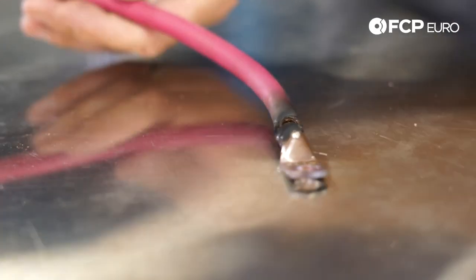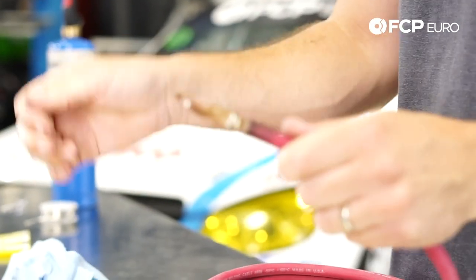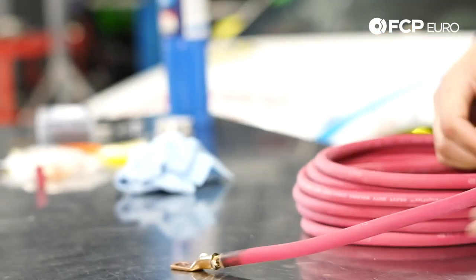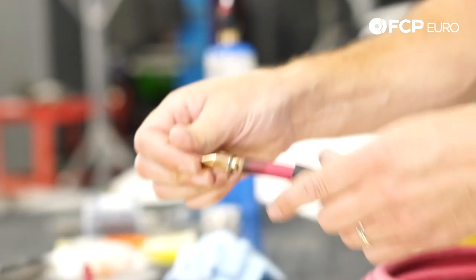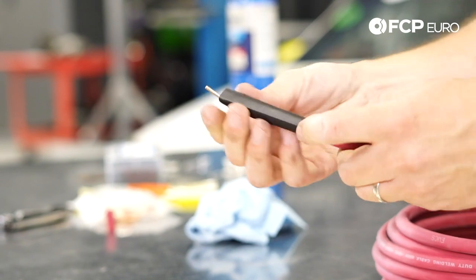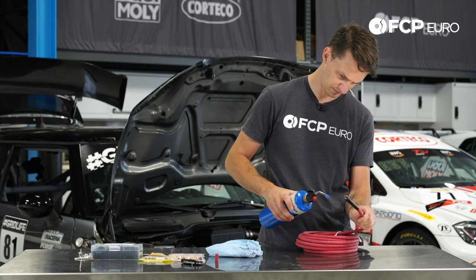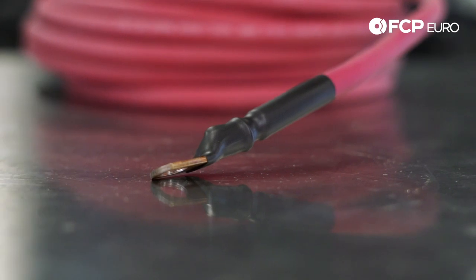Just some rubbing alcohol to clean up our mess. Now we've given the end ample time to cool down — you can see we have a really solid soldered connection there that's not going anywhere and it's going to transfer all the electricity through it properly. We've also run it through some water to make sure it's nice and cool. Now we're going to slide this heat shrink right down — you can see how kind of ugly this is, but now we're going to cover all that up and make it look nice and pretty. Sliding the heat shrink down and over the shoulder — you really want to get right down to the end. Now I'm going to use the torch again and just lightly heat that up and shrink that shrink wrap tubing on it. There we go — we have a really good solid connection for that battery.